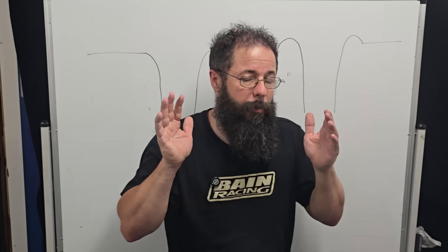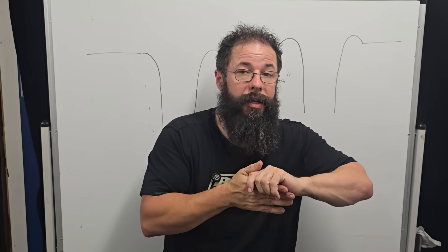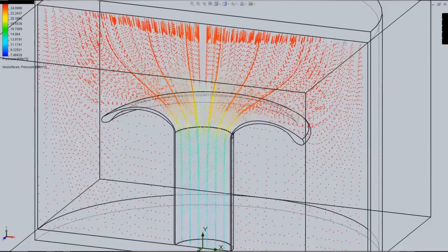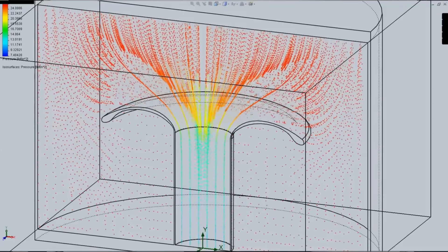The idea of a radius is to target the radius to your airspeed. We're starting to see this now in really smart guys doing billet manifolds — they're far smaller now in the radius. The early days of 5/8 inch were just absolutely crazy. You're getting guys now targeting it properly, like Plasma Man and a few others I've talked to, down near 8 to 10 millimetres — so around five-sixteenths to three-eighths radius. They really understand what the radius's job is: the two functions of wave tuning and the vena contracta. We're just trying to stop the separation. That's its only job.